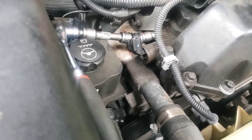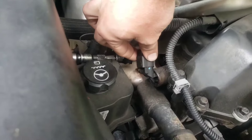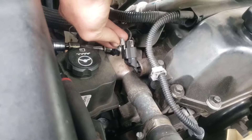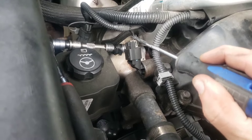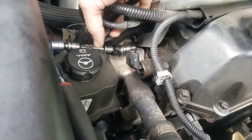Where's our little connector? It's right here. You got this little connector connected right there, but you also have this little hold-down plastic piece clipped down in there. So what you'll do is come on the side of that little clip, take a pick or a little Phillips and pop it up. Then you'll be able to squeeze this connector and pull it up out of your way.